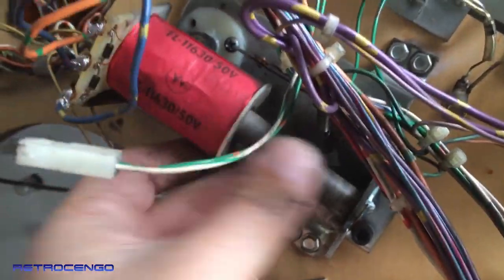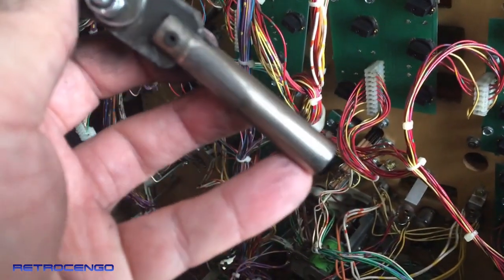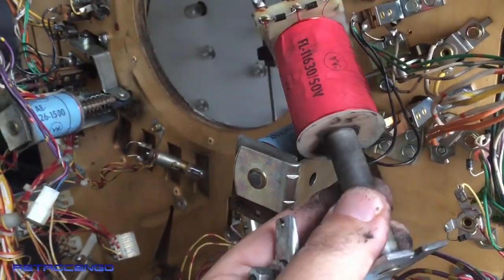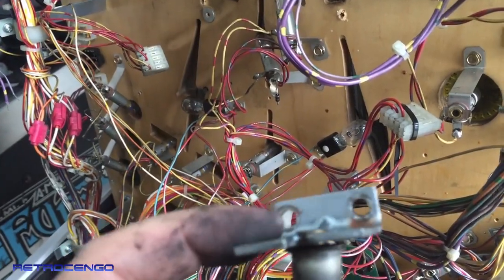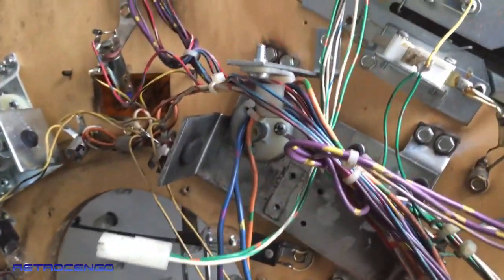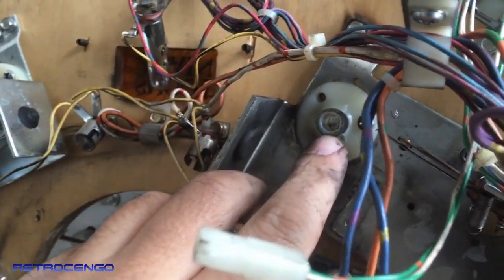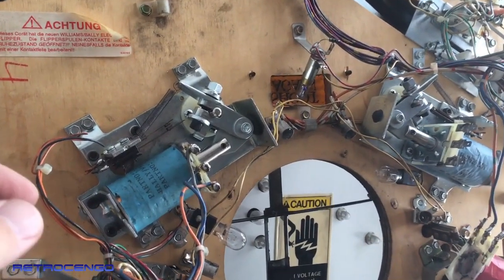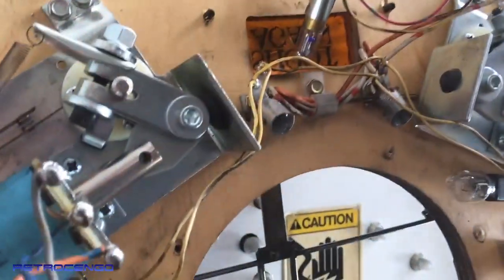This is junk, man. This is garbage. Just look at this coil. This will create friction because of the mushroomed head. I mean, it's all done. Yeah, look at this, guys. This coil stop is definitely dead. So a lot of new parts have to be installed, of course, and the bushing here has to be replaced also. It's gone. It's too wide, man. Everything brand new installed, not soldered in place, just installed, and they are snappy everywhere.